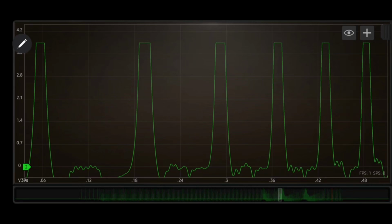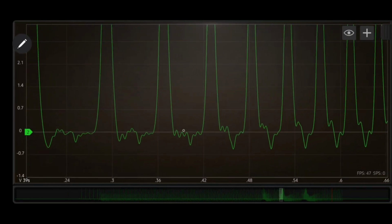Now you also want to see these down here in the valleys. You want this to be like a nice flat line. And because of this turbulence I have going on here, that tells me that these valves are not opening at the right times as we're creating turbulence. So that tells me we're a little bit off time. However, do not use your snap or your decels for timing alone. You shouldn't even use them for timing at all. I'm just saying, by the way that turbulence is right there, that's probably a timing issue because of the way the air is flowing in and the valves opening as opposed to where piston timing is.